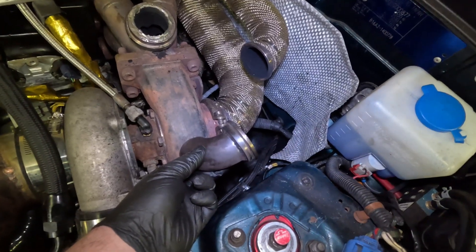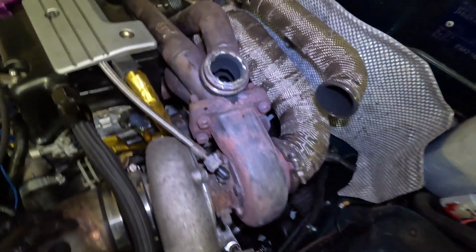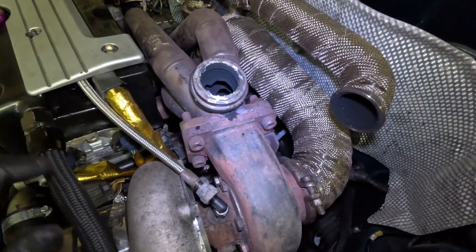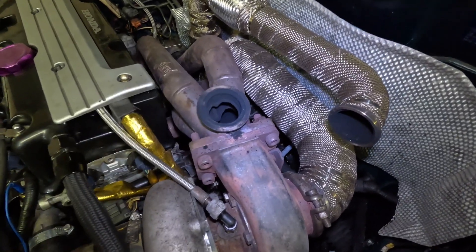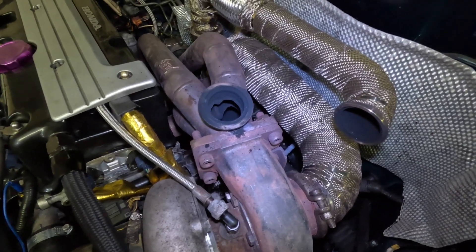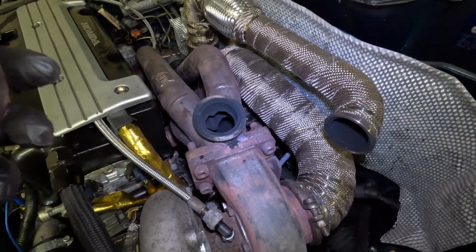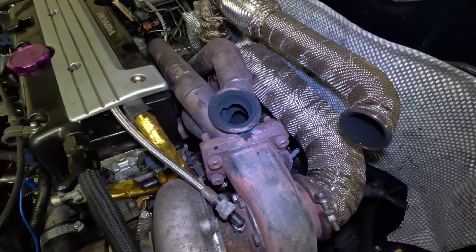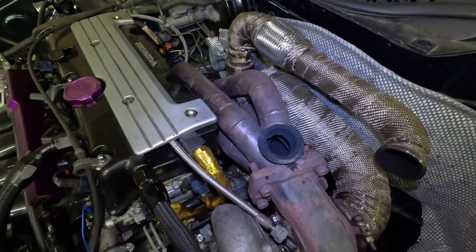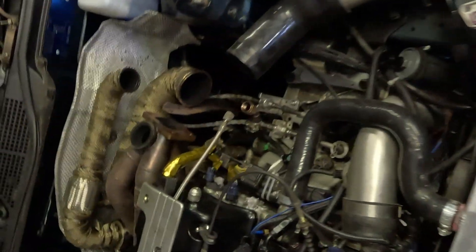The wastegate will now sit there. I tried this when it was running, and other people have said they've made like 14 psi with no wastegate — they just took it off and went down the road still making boost. If you put a piece of bag or polythene or anything there while it's running, it actually tries creating a vacuum and sucking it through. So it is just a bad design, but there's quite a few of these different style manifolds known for it. Just try this out and see if it works — I've marked it up and took the turbo off.